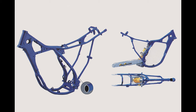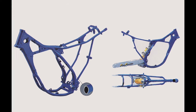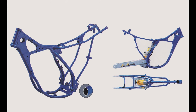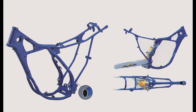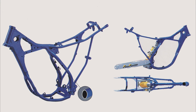Paired with the all-new suspension was a completely redesigned frame that was narrower, lighter, and stronger for 1986. Constructed of tough chromoly steel, the new chassis reduced the components used in its construction by 50% over 1985. The redesigned frame was more compact and narrower through the midsection by half an inch via the use of oval tubing where the rider gripped the machine. The new chassis was also shorter overall, with the RM dropping an inch of wheelbase from 1985.